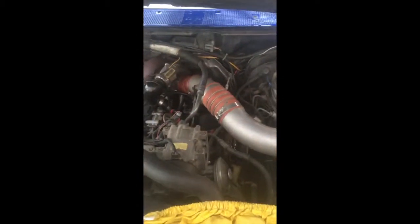The passenger side is done, now moving to the driver's side valve cover gasket. There's some stuff in the way - start with the whole air filter assembly. The air assembly has to come off to get to the driver's side valve cover gasket. Undo this hose clamp at the turbo, get two bracket bolts off - both 10 mil - and then loosen one more hose clamp over here. Then this whole air assembly will slide off.